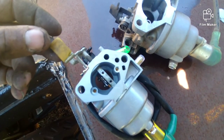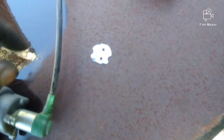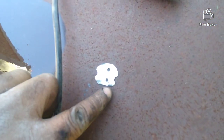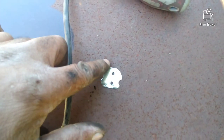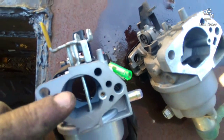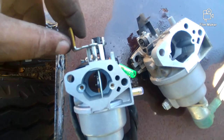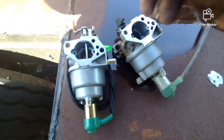And you turn it that way and put the screws back in. But this, usually, the way it sits there, has to be ground down a little bit here. So I just put it on a file, and at the top also, or else it touches the inside, and then the automatic choke won't choke. It gets stuck. It always gets stuck.